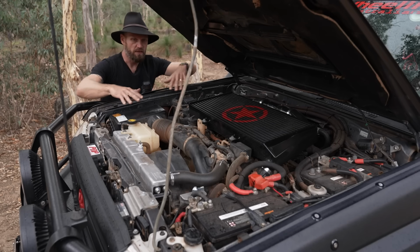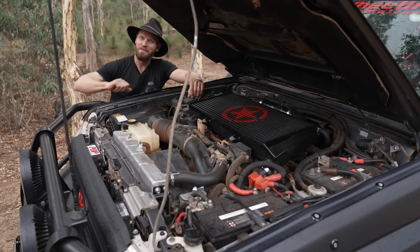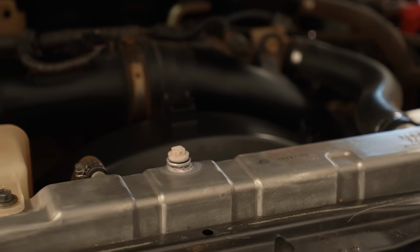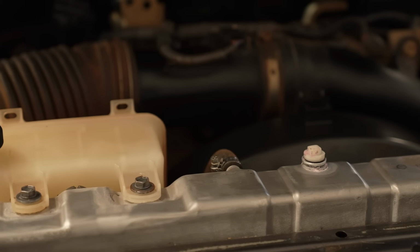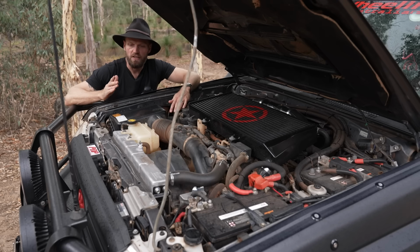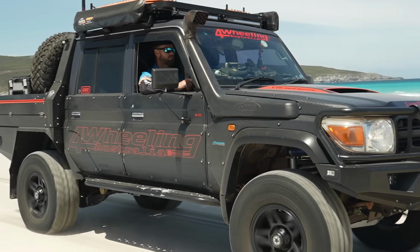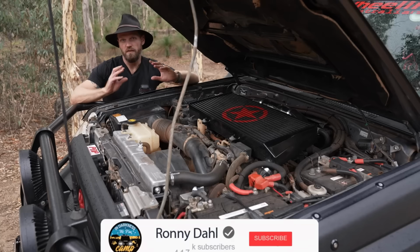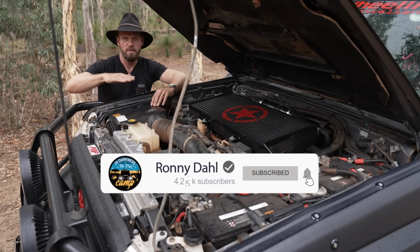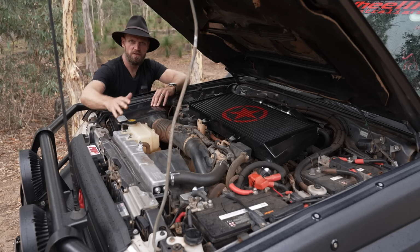Everything I've done since all the other stuff has all been about cooling. Speaking of cooling, we got a Terrain Tamer radiator right here, and that actually came from the Terrain Tamer e-store, sponsors of the show. No, they were happy to help me out with a radiator here. So the old radiator, which was a genuine Toyota, which I've never had an issue with, has been really good, but it was pretty clogged and needed cleaning. So I figured let's chuck one of these in and try that out. This has consistently run the vehicle 2 degrees cooler. I know it's not much. That said, it's been very much consistent though. So it's keeping it around 86 to 87, whereas before it would creep up to 89, maybe 90, and fluctuate a little bit more. This kind of stabilizes that a bit more, which has been great.